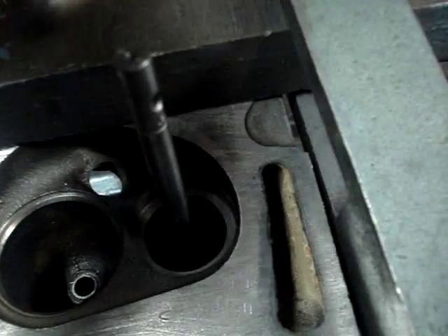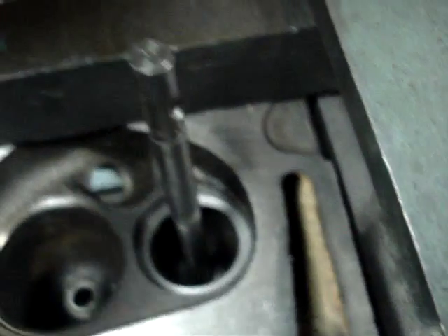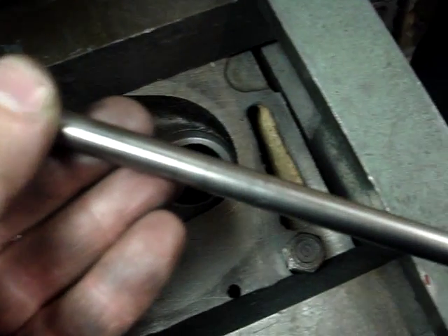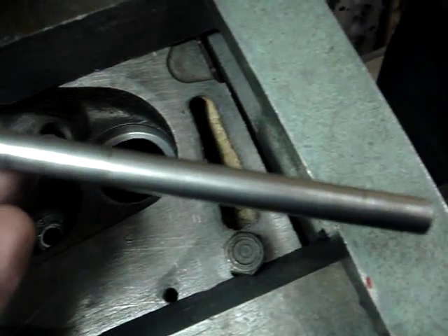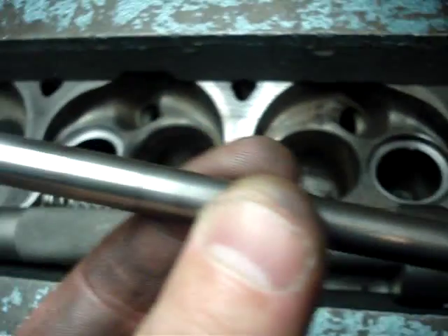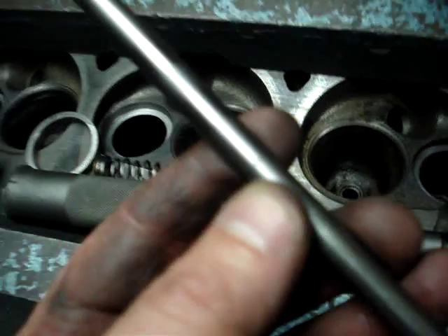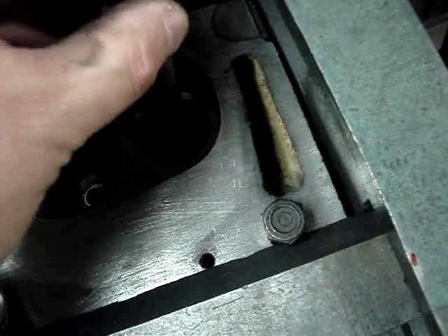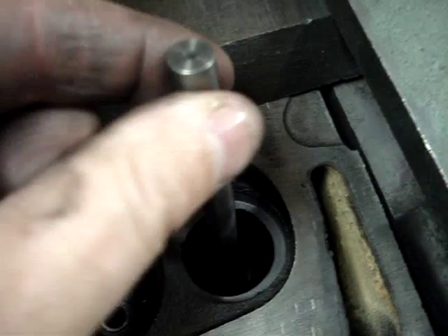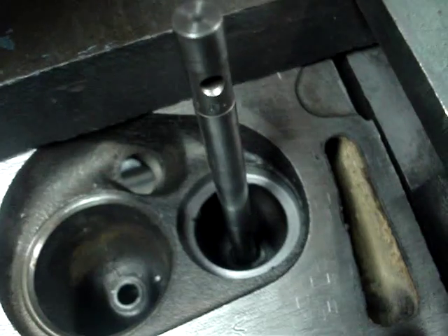We pilot our guide. This is not just a piece of steel — this is a precision pilot. It's precision machined and it's got a step on it. It's designed to go in about three quarters of the way and then get tight right here because it's tapered — it gets bigger as you go up. You put that in, it's a very tight fit, and it precisely pilots and centers that guide perfectly to our seat circumference.